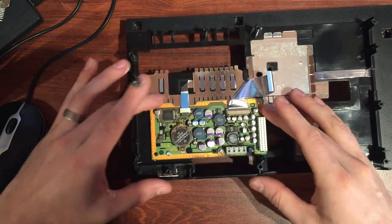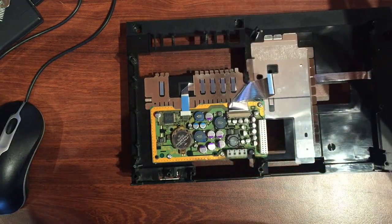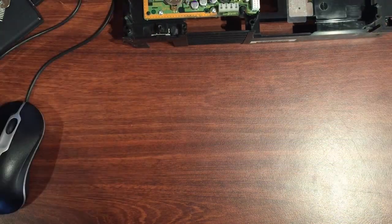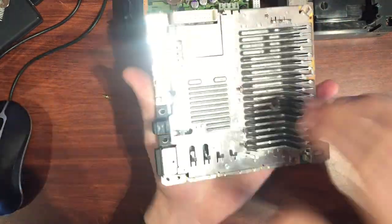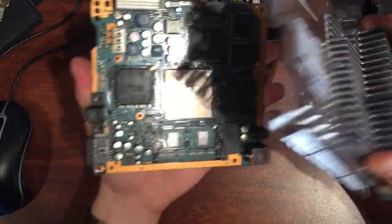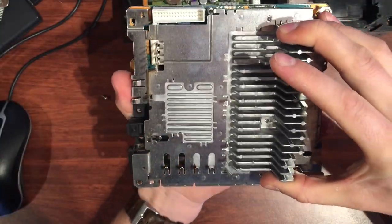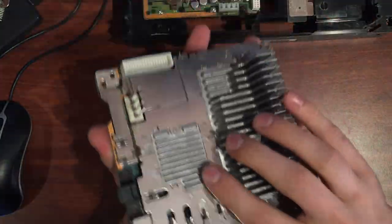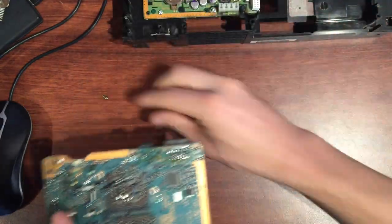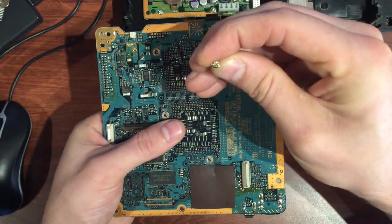The board's back in, ribbon's on, battery's in — that's all secure. Now we'll get the main part and put that on top. Grab the board — I've washed this up. If yours is still in two pieces, just put it back together: align this big hole over the pins and it'll sit back down. Make sure it's nice and flush, then flip it over and put in the four screws that mount the board back to the heatsink — using the flat head screws we pulled out earlier.